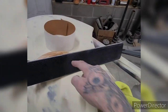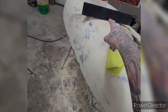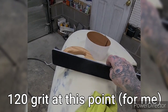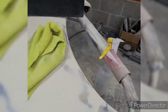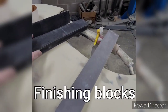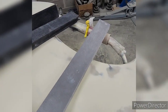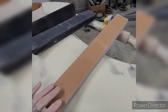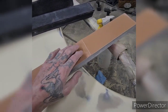Put this down and it'll last probably for the whole time it takes to work on these fenders with that specific tool. The air file works pretty good, but when you do it by hand you get more controlled sanding. When I'm using these blocks I clean these off as well — the paper will stick a lot better and a lot longer. You can see how nice and clean it is underneath. I've used this block on another job but the tooth is gone on this sandpaper, so it will be changed out.